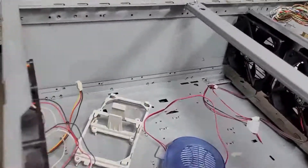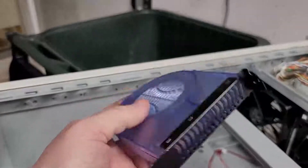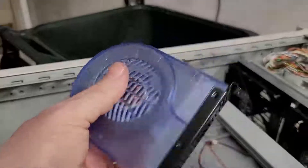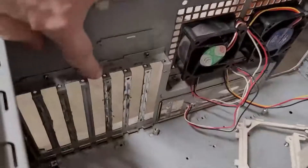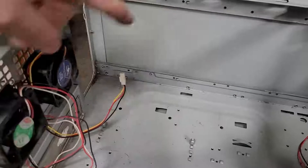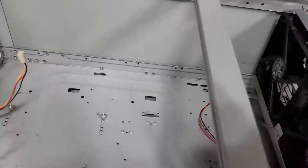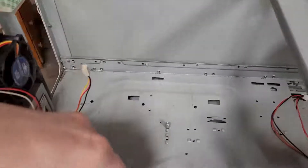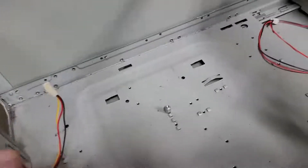The whole goal of this is to drive the airflow so that air comes in cool, then warm, then hot exit. You can also temporarily add independent blowers like this in case you develop a hot zone in the areas of the IO bus board — one of the slots for the PCI side right here. That's usually caused because the power supply is creating what's called a heat feedback loop, keeping a hot zone inside the chassis. You can use a blower to suck that out or assist in sucking it out by mounting it right here, getting that localized air away from other hot processors and keeping the unit pretty cool.